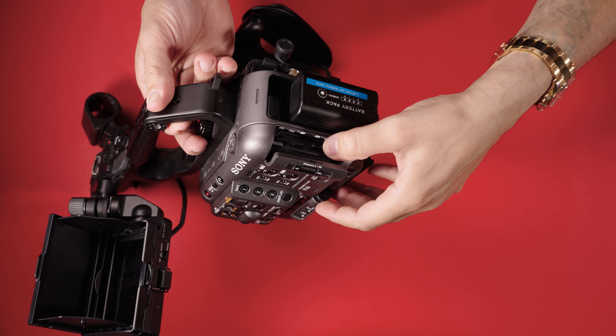Last night at 1:30 AM I was trying to download the firmware to use the touch-to-focus functionality, because I'm about to do something this camera will be perfect for. I downloaded the file and my computer renamed it to bodydata(1).dat — adding a parenthesis because another file with the same name already existed. I put it in the SD card B slot, the only slot that recognizes firmware, and I couldn't execute it. Finally the rep told me it should be bodydata only with no parentheses. My camera is now fully updated.